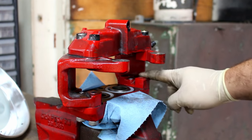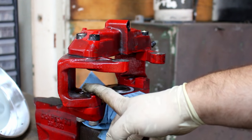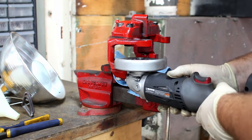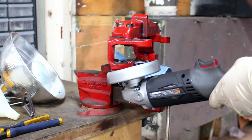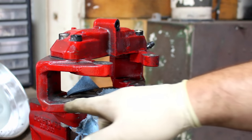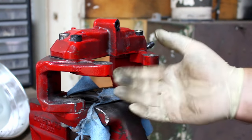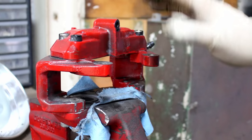These two pieces of metal right here basically need to be ground down flush with this line. So I'm going to take a lot of material off right here and right here, and then install the two washers and it should fit on nicely. It's really unsafe, but the only way I can really get in there is by turning this grinder upside down. It's kind of hard to get in there, but turning it upside down works pretty well. I am at least wearing safety glasses. Now you can see this is practically flush right here. When you go and grind this, just do a little bit at a time and keep test-fitting it with two washers, because you don't want to take too much off and you don't want to grind more than necessary. So take a little bit off and keep test-fitting it.